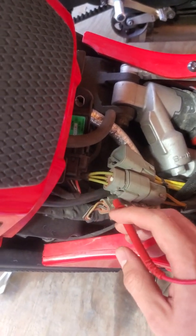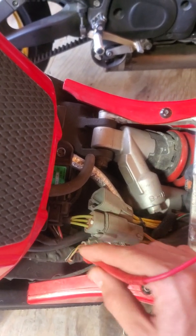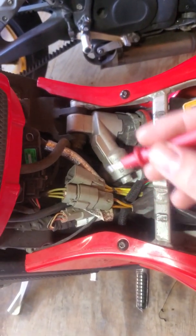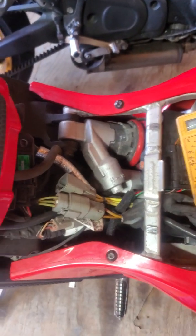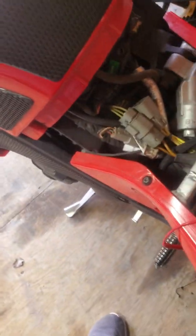I'm guessing I won't get the 14 volts I should see. I expect to get around 4.5 volts on two of the phases and zero or one volt on one phase, because the indications I saw really tell me I only lost one phase. Losing one phase is enough for the bike to die at idle, but when you rev it up the other two phases can sometimes compensate — which is what I suspect was happening yesterday.